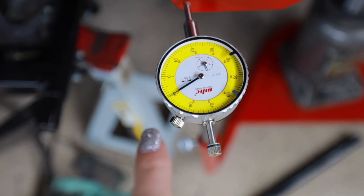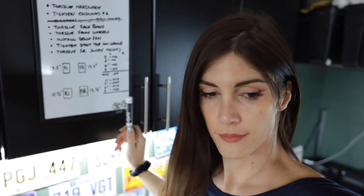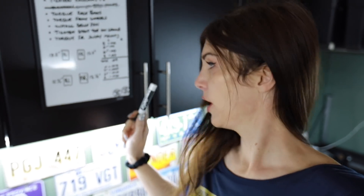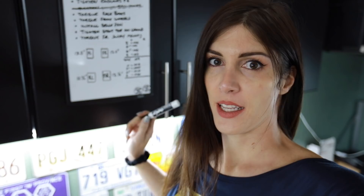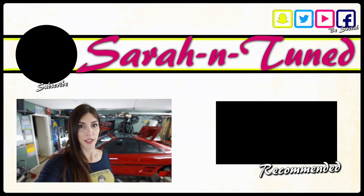That is money right there. At two inches of suspension compression — almost at bump stop — this one is at 90 and this one is at 72. Final verdict: 18 thousandths of an inch at two inches of compression, seven thousandths at one inch, 10 thousandths at one inch of droop, and 50 thousandths when fully drooped. Thank you for fabricating these pieces. Be sure to check out his video on the entire fabrication process — machining these parts on his lathe from scratch, very detailed step-by-step with measurements, setting up the lathe, et cetera. He's going to start doing YouTube content on machining, fabricating, and his own project Baja truck build. Check it out down below — I'm going to get this thing aligned in the next video, so I'll see you guys soon.